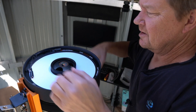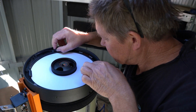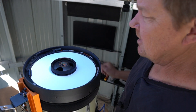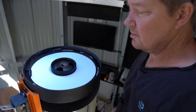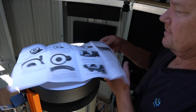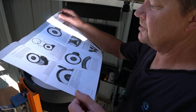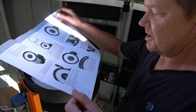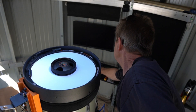Now to orientate. Okay, so the compliance label is down there near the dovetail. There we go — I think I've lined up the screws. So apparently that's how it's got to be. Next step: reinstall the screws — removed previously — only finger tighten initially. Then when tightening the screws with your Phillips head screwdriver, use a cross pattern, like you do when changing a wheel. So let's get to that.